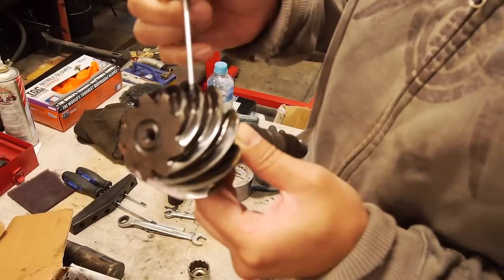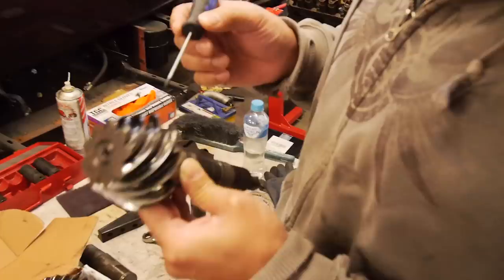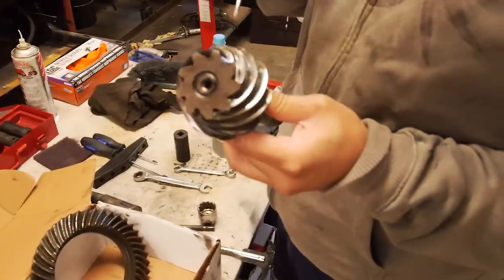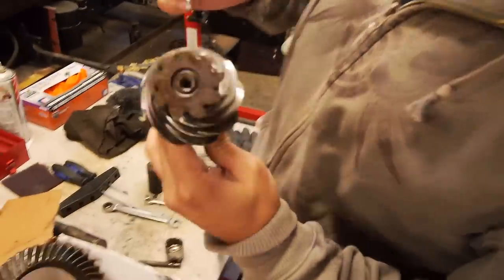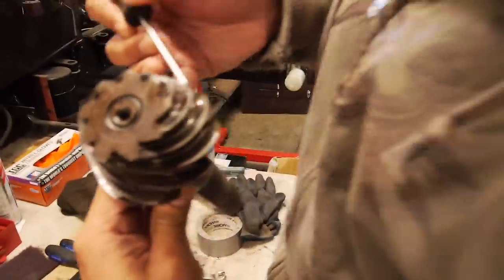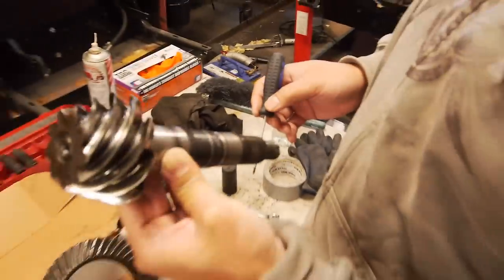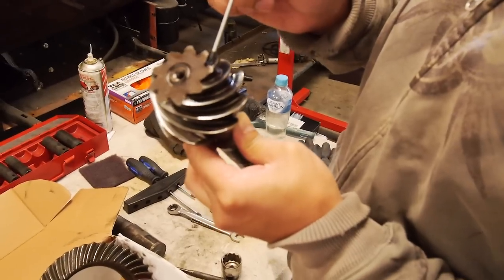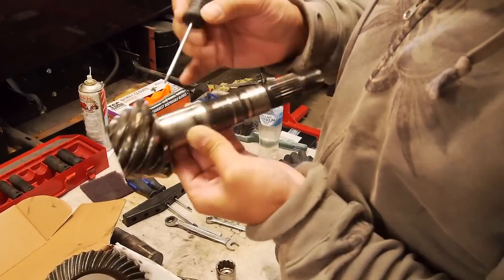That's what can happen if you don't run enough oil or if you don't have the EP additive. That's why it smells really, really strong, because it's sulfur, which is a heat-activated EP additive. The best smell, it prevents this type of wear. See here, where the engagement finishes? There's no way I'd waste a set of bearings putting on that unless you have to. Because the root's so thin, it'll be noisy when we set it up, and you also run the risk of cracking the gear.